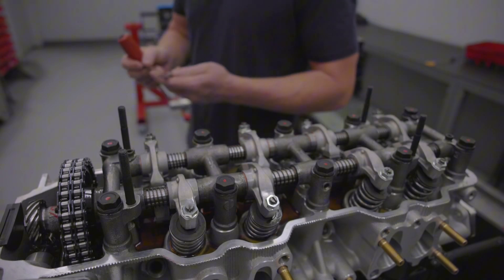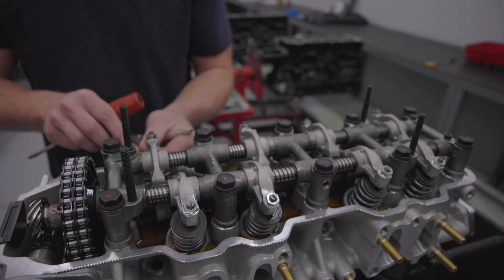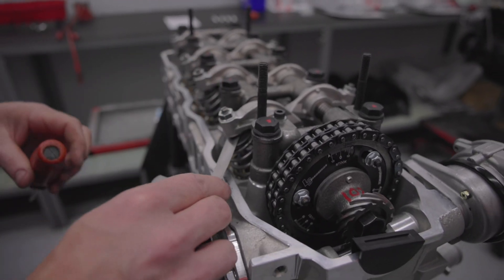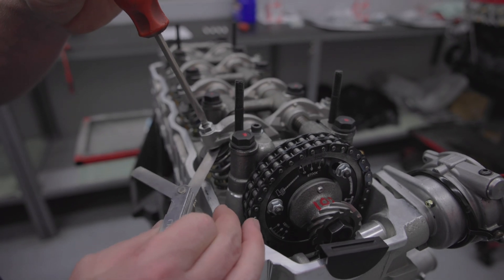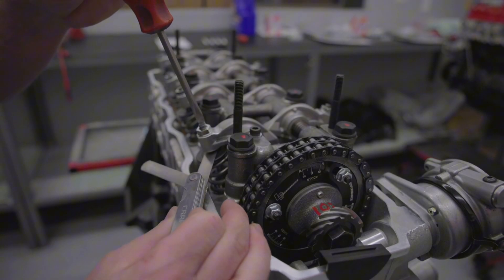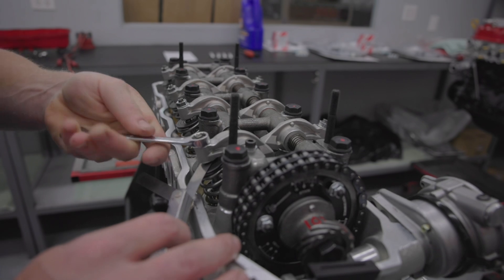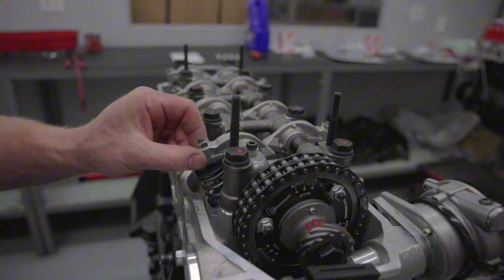You want 8 thousandths on your intake and 12 thousandths on your exhaust. So we'll get our feeler gauge in there with a little flat head screwdriver. Take our 8 thousandths feeler gauge to the first one, get it until the screw is just barely touching it. You don't want to clamp the feeler gauge — you want it to just barely slide through there with just a little bit of tension. If you can't pull or push on it without too much force, it's too tight. Then cinch it down. You don't have to get this killer tight, it's just aluminum. Just snug that up, double check — it slides right through there. And that one is done.